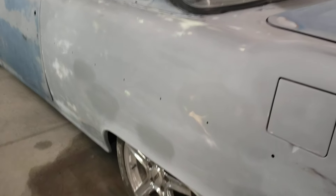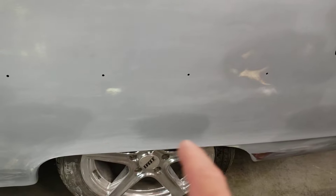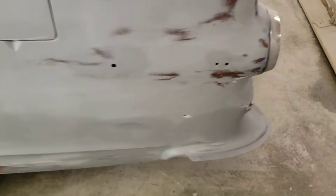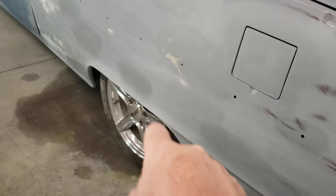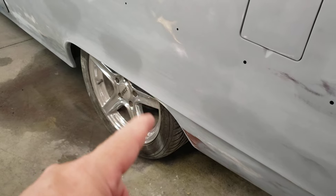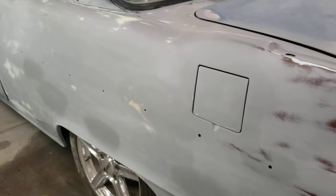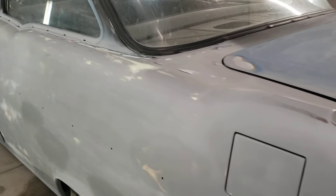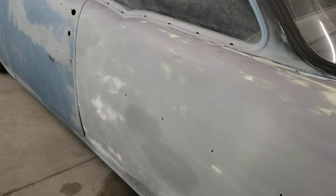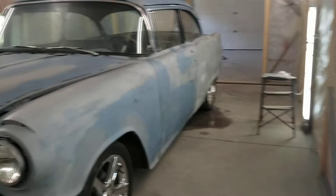The question of whether filler works on top of metal with good tooth — absolutely — but it must be good metal. The other things we found as we started taking the filler off down low: there were patches where they had handcrafted all this body line, done with an electric spot welder, just lapped and not countersunk or flanged in, and then filled. None of that was failing except a couple spots where there was rust coming from where sand off the tire wore the paint down to metal and it went in underneath. But if you did good bodywork with good tooth, everything seemed to hold — with the exception of that green sticky stuff around those welds. Once we took all the filler off, there was no rust under the filler other than those spots. Anything you put on will seal it and keep the air and moisture out.